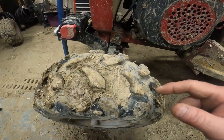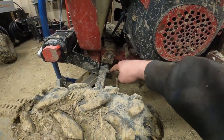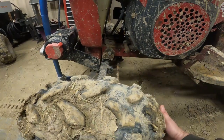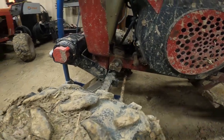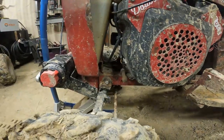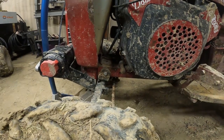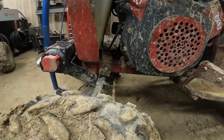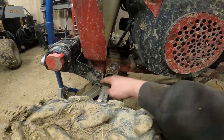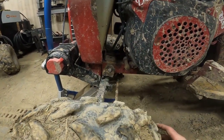And what I'm going to do is I have a plan off of this tab, which is a reverse tab that would normally work on the John Deere's. It would push against a plate, so you don't get this stuff like this. And these John Deere axles are narrower at the pivot pin than a wheel horse. So I had to put spacers and all that. I could move the ear forward. I'm not going to do that, because if I ever want to throw a horse axle back in this, I don't want to do that. So this boss would normally be the other way forward and be pushing against a plate, and there's one on the other side, right? So you don't get this rock and roll. You don't get that wear.